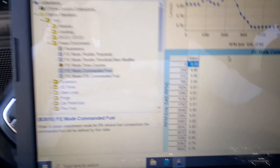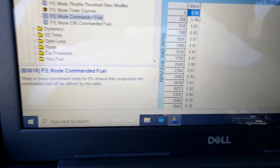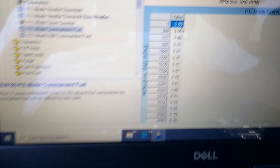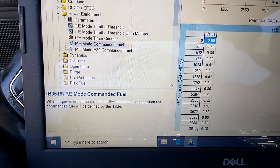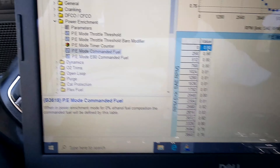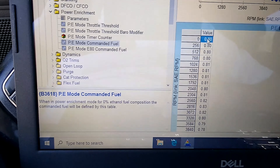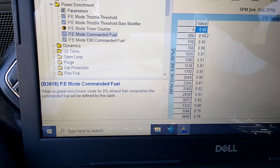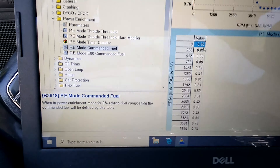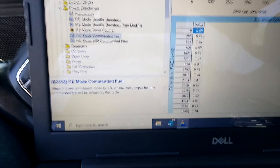Here's the recommended sequence for this simple performance tune. First, crank your RPM up to about 6,000 RPM on a standard LS truck motor. If you have an L9H or engine without active fuel management, you can probably go up to about 6,200 RPM. The LS3 didn't have VVT or active fuel management and you can really wind those up. On a non-AFM engine, go to about 6,200 RPM; on an AFM engine, stay safe at 6,000 RPM or less.